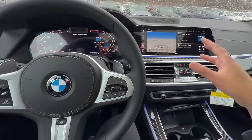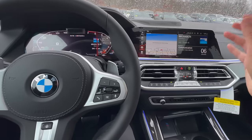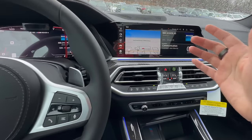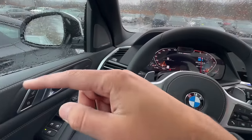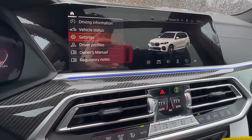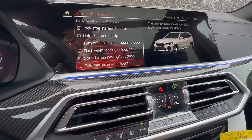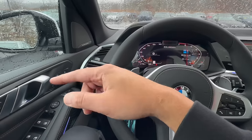These next few are very software related, so we're going to deep dive into iDrive 7. Many of these features also work for iDrive 8. One feature to consider is having BMW fold in your mirrors whenever you lock the car — by default, you do have to enable it first. Go into Car, then Settings, then scroll to Doors and Vehicle Access, scroll down, and check this option on. Now whenever you lock your vehicle, it will simply fold in the mirrors so nobody can bump into them.